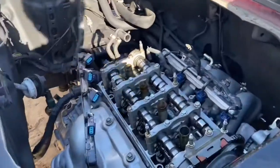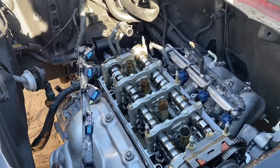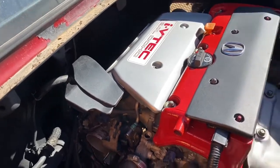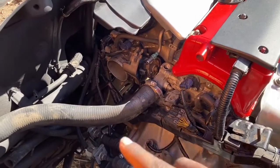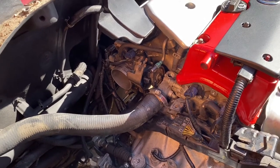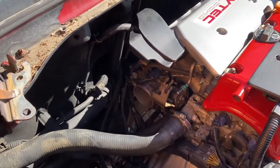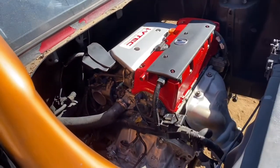I'm going to go ahead and start getting those things addressed and we'll come back and see what we need to do next. I got my shift linkage in here now, got my brake hose on there as well, got my valve cover on — just getting everything kind of test fitted for now. The radiator hose works right there; they just run stock so you don't have to change the top one at all, besides maybe getting a filler neck or an adapter from Toyanda where you just cut it right here and they give you an adapter to have the radiator filler neck right there as well.